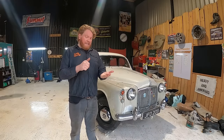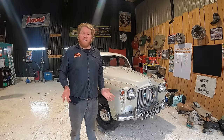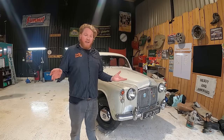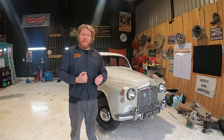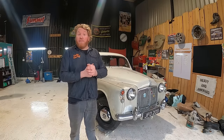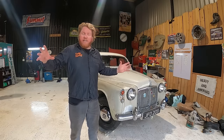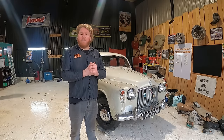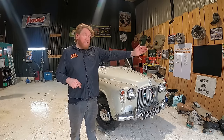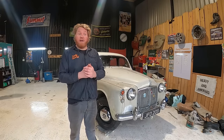The battery and the battery wires and the start motor wires all want replacing. I need to do this with other cars as well. So I'm gonna order some stuff, some tools, big crimping tools, lots of big ends and all this sort of stuff in bulk from car part supplies, car builder supplies, and load of big chunky red cable, load of big chunky black cable, and just make a load of new cables for this. So I need the one that goes from the starter solenoid to the start motor, and then the negative cable and the positive cable for the battery.